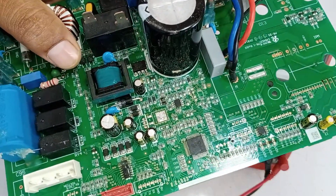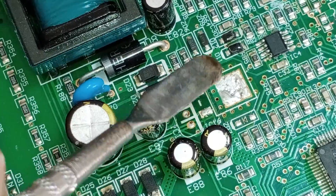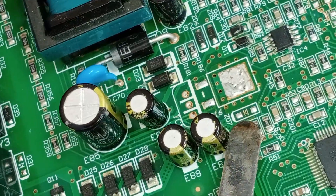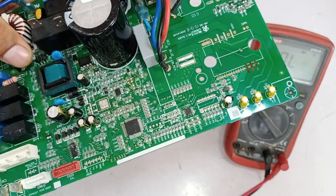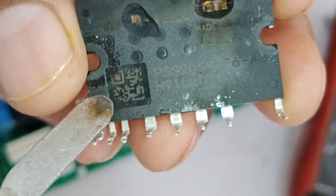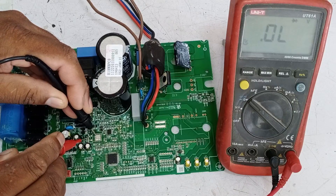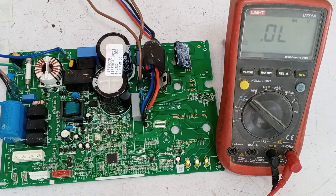I have desoldered the voltage regulator from the circuit board. After removing it, its voltage drop is shown fine. However, the center diode was faulty both inside and outside the circuit board. The compressor sent back voltages onto the circuit board, damaging the low side. The IPM is blown from the low-side pins while the high-side pins are okay. The output trace of the voltage regulator is shorted with the ground pin, which means the microcontroller or another component in the circuit board is faulty.